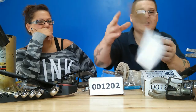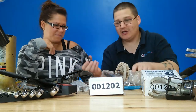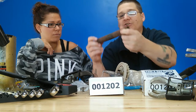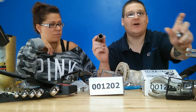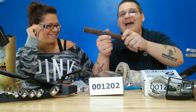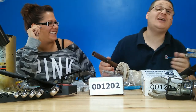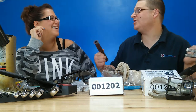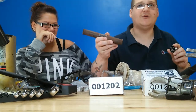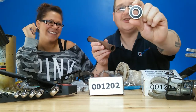Alright, we're going to take out the bearing and get this video going. There's a brand new bearing. What you want to do is use a three-quarter pipe nipple — a black pipe nipple from Home Depot — because the outer race diameter fits on the inner race of the bearing. You want to press on the inner race, not the outer race.